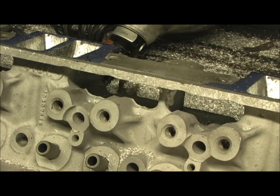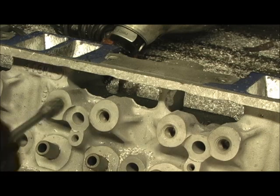I thread the spark plug holes and I even take — especially on aluminum heads, but I've gotten where I do it on all of them — a little bit of gray anti-seize grease and put it in the spark plug holes, so they have no choice but to have it on there when they get the head. Grinding the casting flash, blending the water passages, opening the oil passages, cleaning all the threads, putting the anti-seize on — that is attention to detail. Not only do they get a performance head that kicks ass, but they know when they go to bolt it on there ain't gonna be a problem. It takes a little bit of time, but I promise you in the long run if you do this, you will have a very big return customer base.